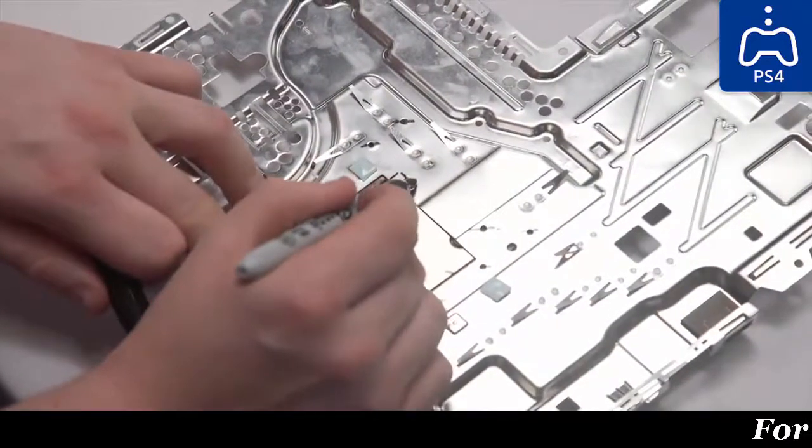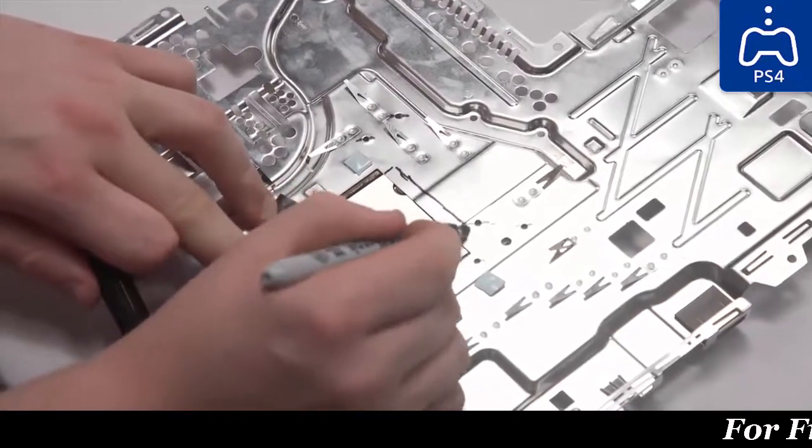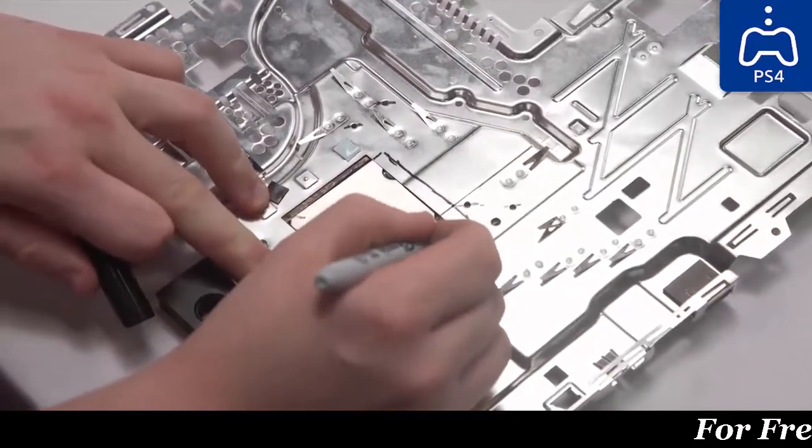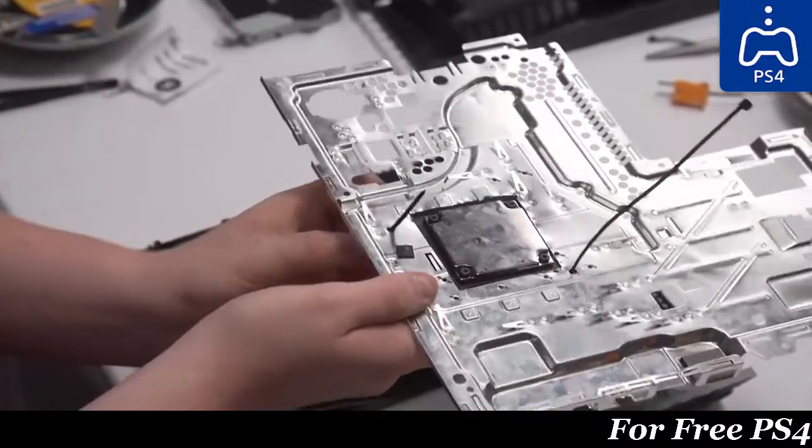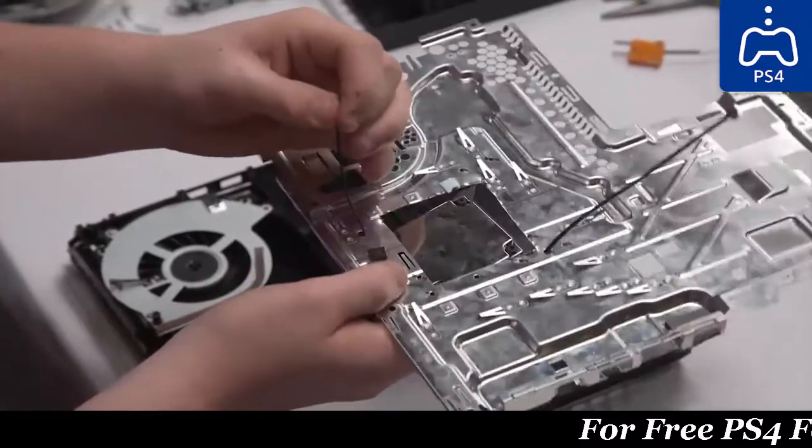By drilling through the rivets with a couple of different size bits, we needed to cut away the motherboard tray with some aviation shears. We actually ended up needing straight, right, and left angle for this, but you could just use a Dremel. Then we routed zip ties through the block, through the motherboard, and through the tray.